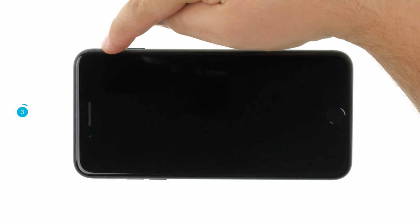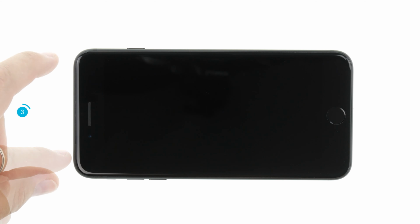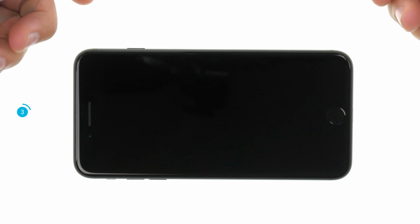The device opens to the side of the standby button. The flex cables of the display are located on this side. The flex cables are fragile and should not be overstretched. In addition, the display is hooked in at the top. This means that the display must first be pulled a little to the bottom to unhook it before it can be folded to the side.